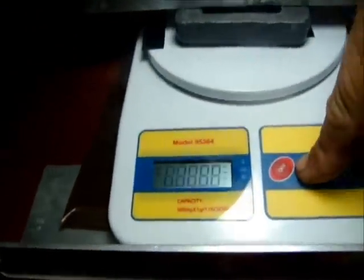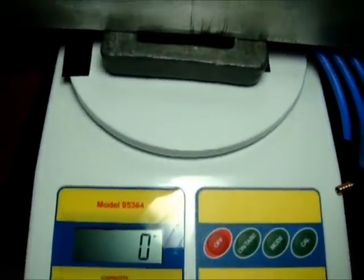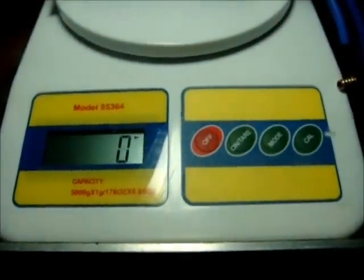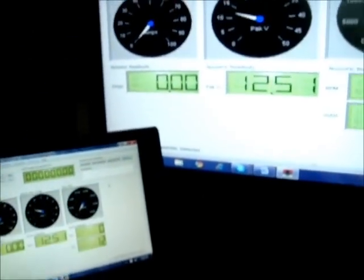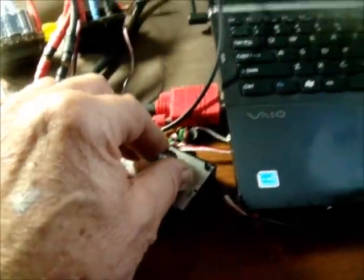What I'm going to do is tare the weight on my scale. This motor position is identical to what we've done before. I'll verify that the Astro data is reading correctly — my scale is down to zero. Pack voltage compares very well with the voltage given in the Astroflight recorder. So let's start the test — I'll crank up the RPM using my little servo control.